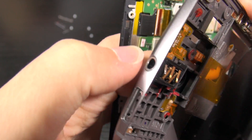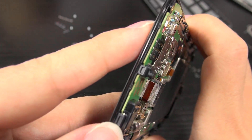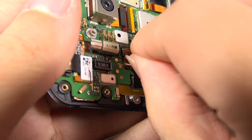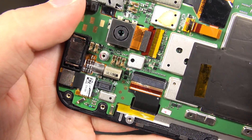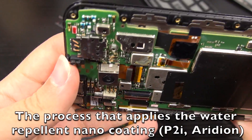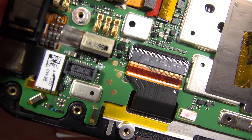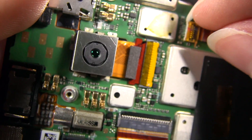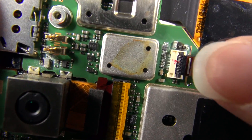You can see the contacts for the standard headphone jack touching right here on the board. I'm curious about this SIM tray — it hasn't been working since I got this device; somebody did something to it. All these connectors have kapton tape on top of them. It seems they leave the kapton tape there for protective reasons, but they also say the device is put through their iridian P2i process supposed to cover all internal components. If the tape moves when you put it in water, all of these parts are left unprotected. We can see there are definitely burn marks here.